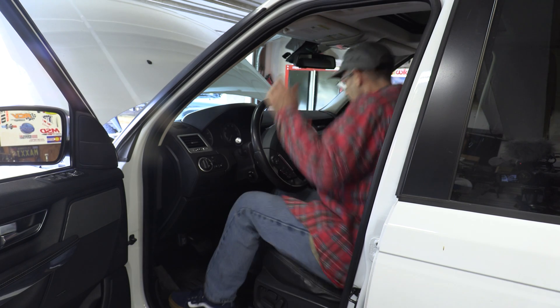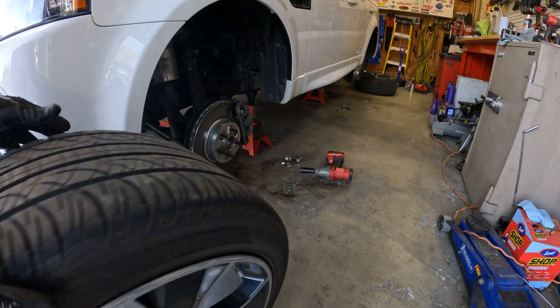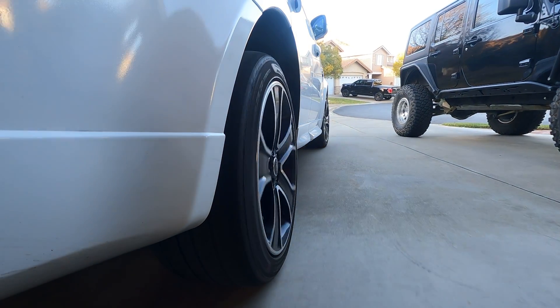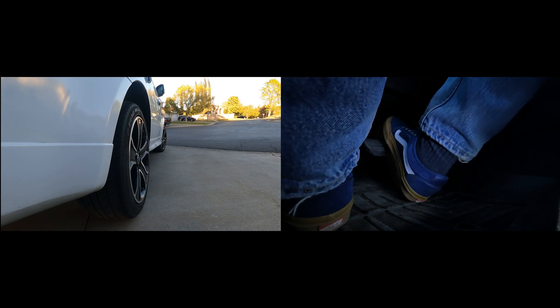Now for a quick test — let's hop in and give it a start. The pedal feels rock solid right now, but that's cheating. Better. So all we have to do now is test drive it. Quick word of advice: after you do anything with your braking system, before you haul out onto the highway, move it a little bit and work the brake to make sure you have brakes. There have been times where you push the pads back and the pedal goes to the floor the first time you expect a brake pedal. But my pedal right now — oh my gosh — actually grabs way sooner than it used to.